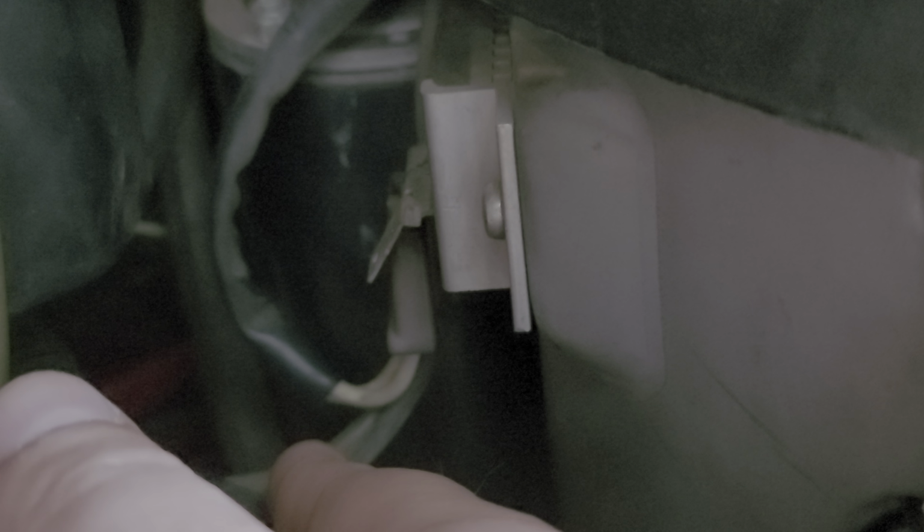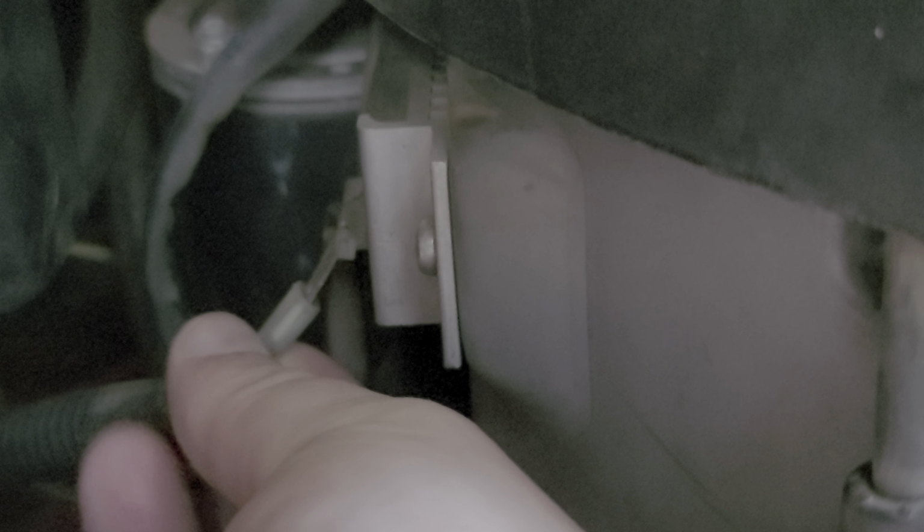And they do measure approximately at idle, it's 16.5 volts AC. And at wide open throttle, it's 33 volts. At half throttle, it's around 30 volts AC. So it's getting AC, but for some reason, this unit is not charging.